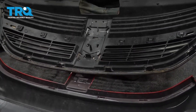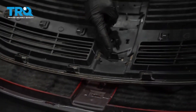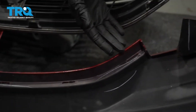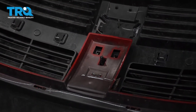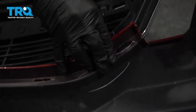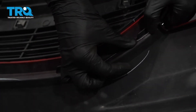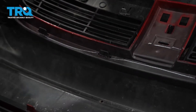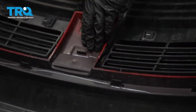Now we can get the upper grille onto the bumper. What we want to pay attention to is all of our locking tabs — they go all the way across the bottom, but we also want to pay attention to the center one as well. Looking at the bumper cover, you can see exactly where all of those tabs are supposed to go. Let's slide this in and line up the center hole as a guideline, then bring this up into position and start lining up all of our locking tabs along the bumper cover. Once you feel they're lined up, press them in. Sometimes you have to start in the center, sometimes along an edge — whatever you have to do to get it locked in. Double-check to make sure they're all secure, then lock in the center as well.